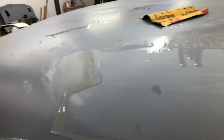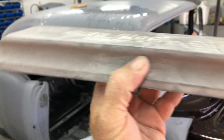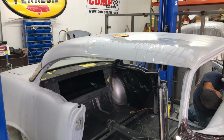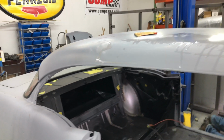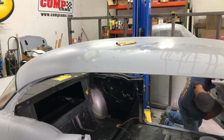And then the roof, same, 400. I'll get that, but I'm going to use a long block right here, and I'll rake on the Dura block. I'm going to use that block to wet sand the roof. Bit of a pain in the butt, but it keeps it nice and flat, eh? So 2 hands and just go over it nice and 400 grit, go over it, and then 600 I'll do when it gets painted. So any road grime or whatever will come off with the 600.